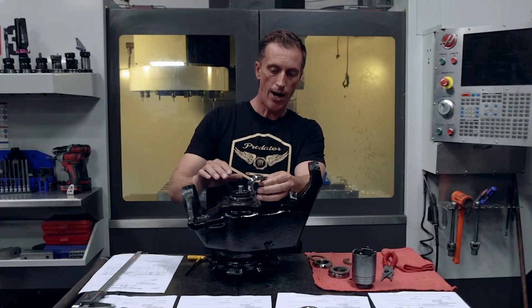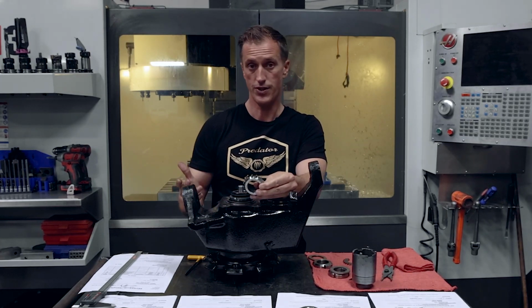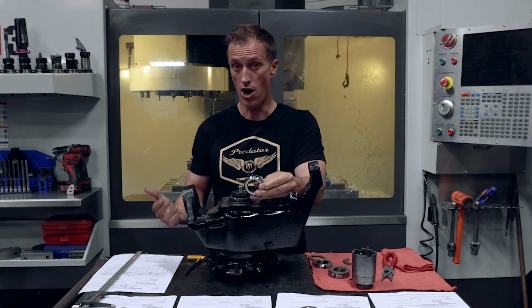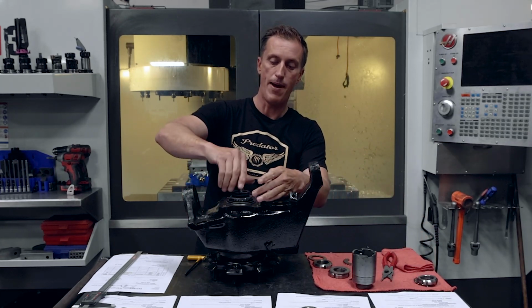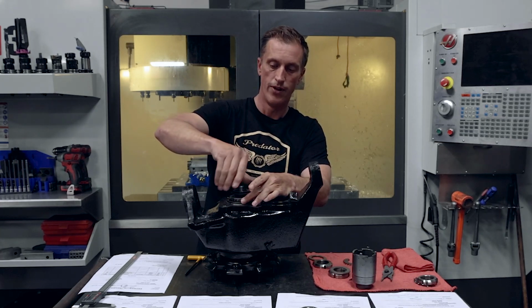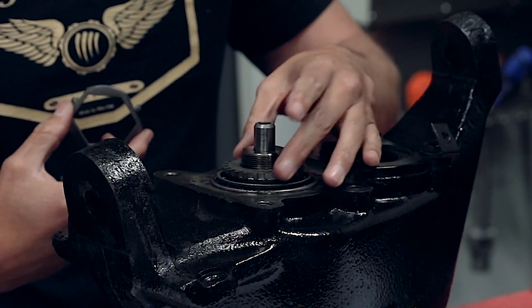This one, I would say, is slightly better than the factory Humvee. Not much so, because first off, you have that false sense of security that they're locked in place, you're good to go, they're never going anywhere, and they're not, because you're really just relying on that one tab that has a tremendous amount of slop to hold you in place. And this guy backs off and the whole assembly fails. Now, as you can see here, we've got this washer here completely spinning.